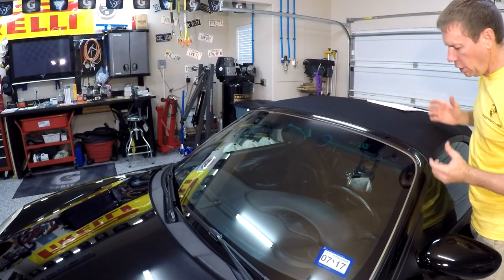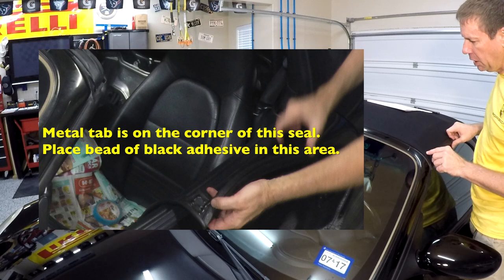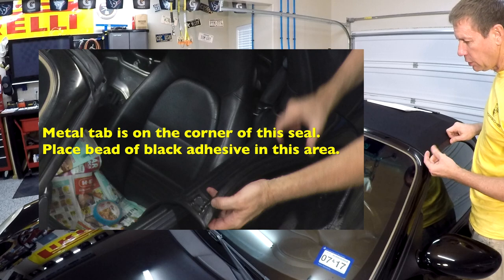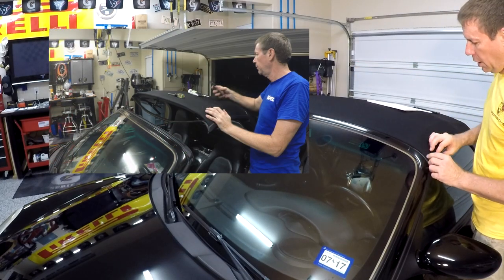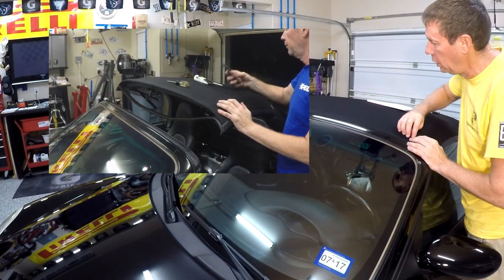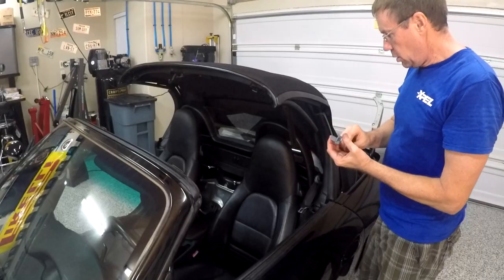Once that's all around, put that long rubber piece in — it has the two upper window seals as well as the one that goes across the front. Put a little bead of seal in the corner as shown, put the screw up in there, and that'll hold everything in place. Make sure the metal tab on that corner goes into the slot — slide it in, put the screw in. Then put the metal plate along the front edge, the seal goes between the plate and the roof, and secure it with those six screws.